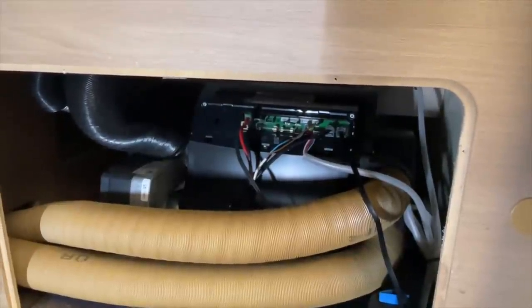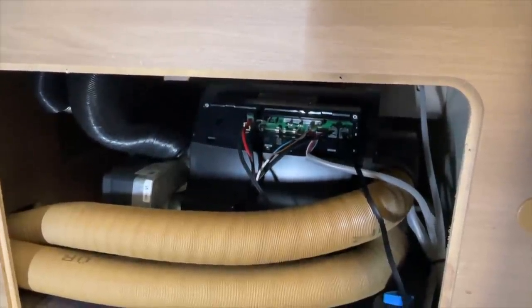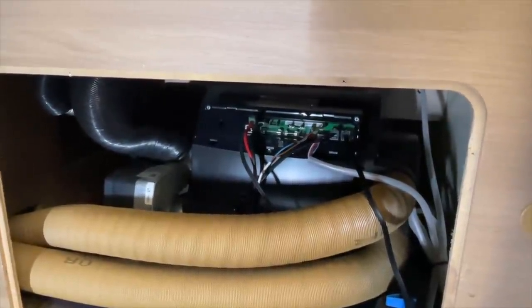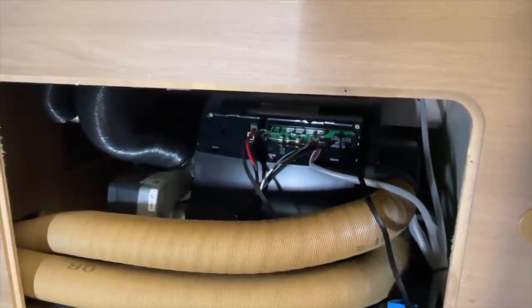By always running only at half mast, too many residues remain in the combustion chamber. The glow pin soots up, the entire combustion chamber becomes blocked, and eventually the heater says no, I can't do this anymore. That is one of the main reasons why heaters fail. And based on how the customer described it to me, I believe that's the situation we have here.